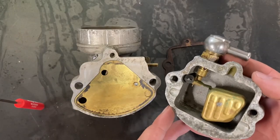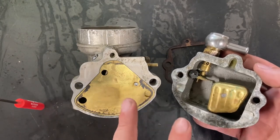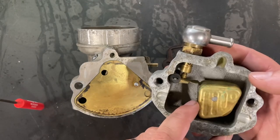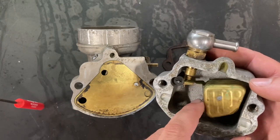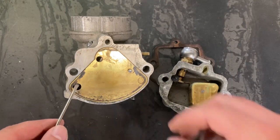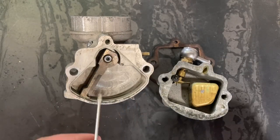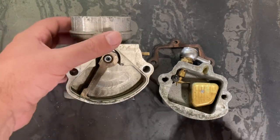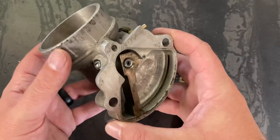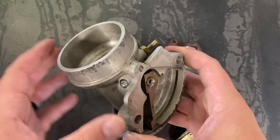Now the first thing you'll probably notice about the Fish carburetor is that it's built extremely well — it's very robust. The float chamber is split into two sections. You have one half that operates very similarly to the Holley 94s or your Strombergs — you have your float, your needle and seat, and your inlet. The second half is separated by a thin brass sheet that is beautifully machined into the casting, and inside this void there is an arm actuated on the same shaft as your throttle plate.